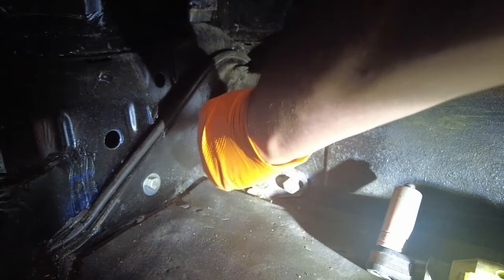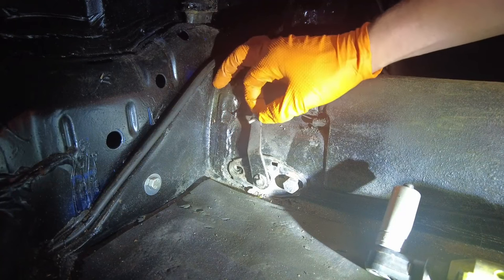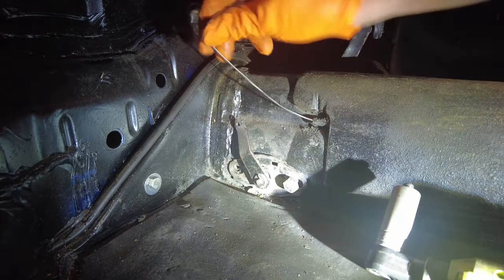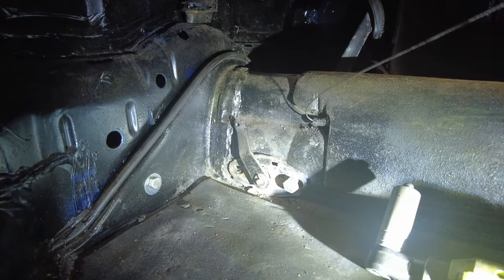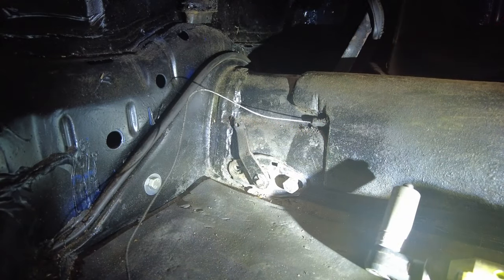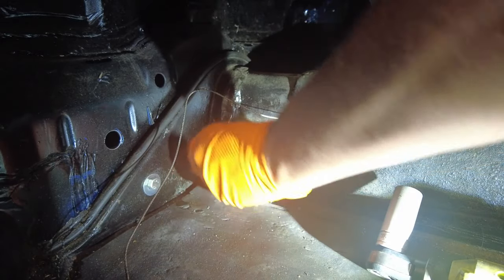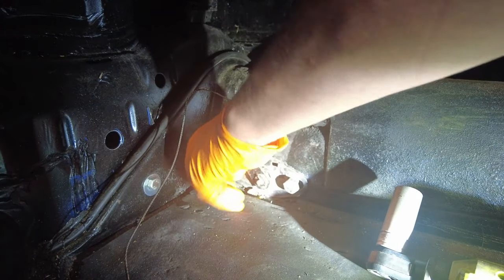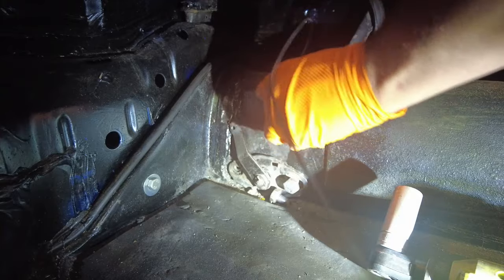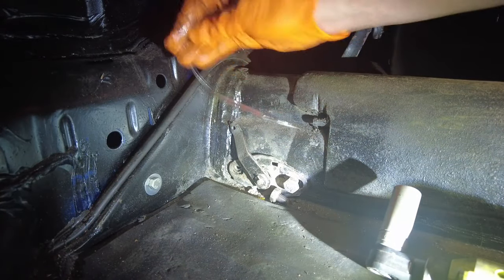It's actually better if you don't remove the bolts all the way, because there are slots cut in the cover, and if you undo the bolts all the way you're actually undoing your pedal box. And thus is revealed the accelerator cable end. You'll see here that this is the arm that comes off. Normally there's a circlip down there but I've done a bodge and a bit of lock wire — I really need to do something about that. So you just unhook the little crank end and you can draw the cable. Now if you have a nice clean tidy interior and a well-greased cable — see it's getting snagged there — I would suggest you be very careful and maybe put some cardboard down so that you don't destroy your carpets, because even clean grease you still don't want on your carpets. I was able to get the carpet out of here because it's not actually glued down. There we go — it snagged on something there anyway. That is the cable now removed.